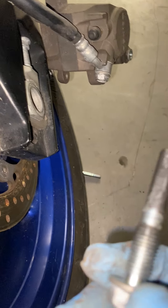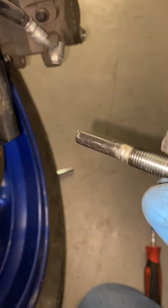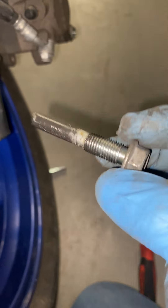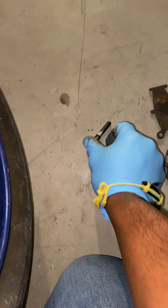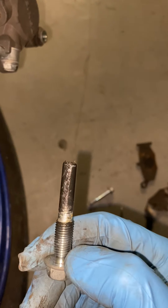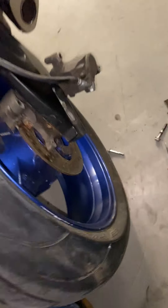These pins are really important too. I hardly see them go bad, but it's always good to grease them — not excessive grease that it's gonna melt and drip on your rotors and mess your brakes up, but just enough so it stays lubricated and hinders it from getting corroded.